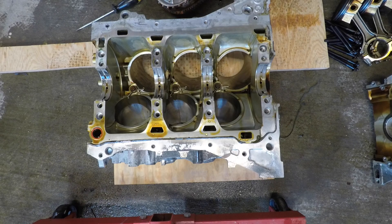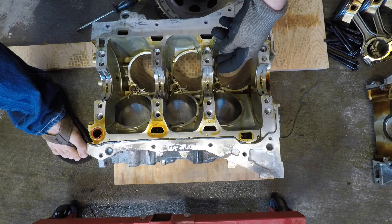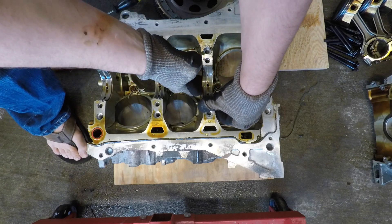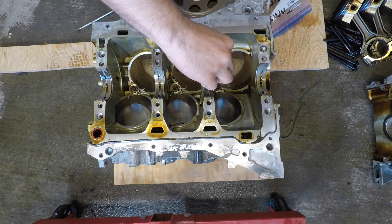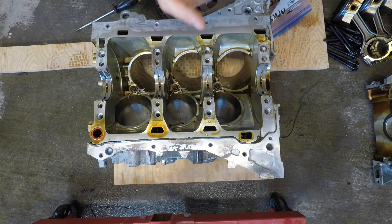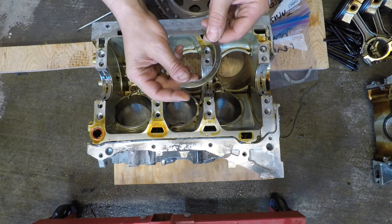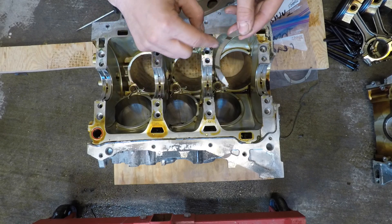All the bearings stayed on the bottom. I'll just turn this up — turn the crank up on the flex plate. And there's one thrust bearing and the second one here. I have one bag for the rear thrust bearing. One side does not have grooves; the other side does. The oil grooves go to the outside of the engine. Same thing with the front one — smooth side goes toward where the journal sits, and the oil grooves go to the outside.